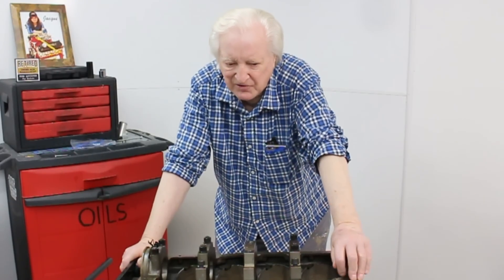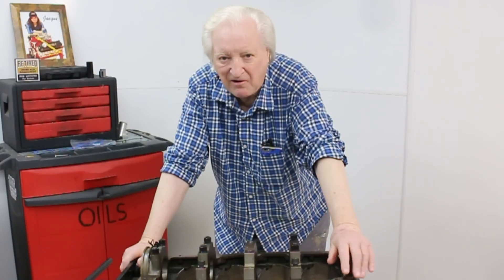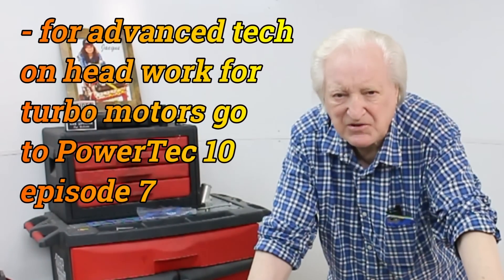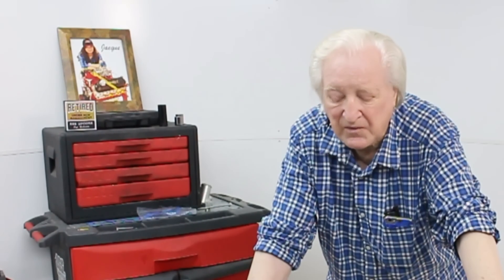Getting horsepower from a turbo motor efficiently means getting the most horsepower for the least boost. How do you do that? What are the things you have to take care of? Well, mostly getting rid of exhaust efficiently. That means the first step is to have a cylinder head that's properly modified for turbo use — see PowerTech 10 episode 7 for all the reasons why what you have for normally aspirated is not optimum for turbo. The second thing is having an efficient exhaust system between the engine and turbo. Lots of back pressure here means you have to use more boost to get the same power, which means cylinder pressures are up. That's what ultimately will break the engine — it will either melt exhaust valves or break the block. So take care about that.